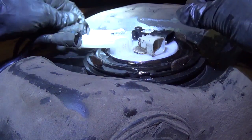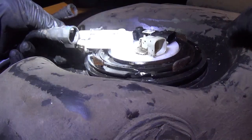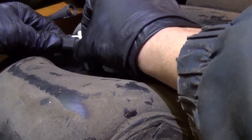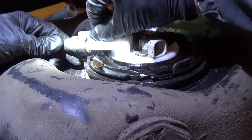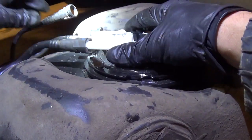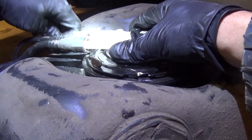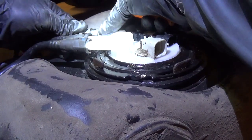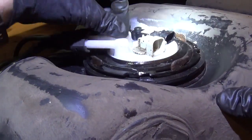Putting on those little plastic doodads — there's one, there's two. Now our hoses should clip right on. Make sure the little clips engage — right there, cool. There's our evap, and finally our return hose. The o-rings are inside of here, so this should be good. I think we're just about ready to install our gas tank.